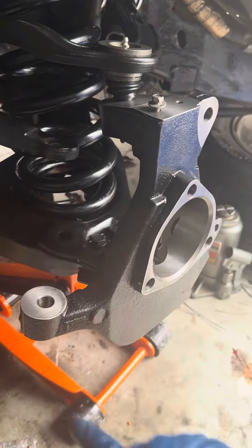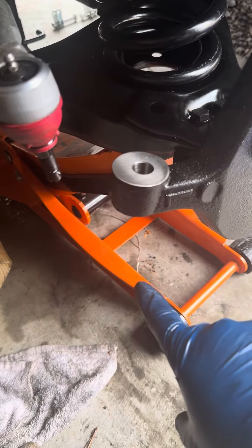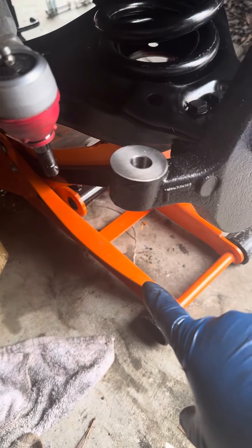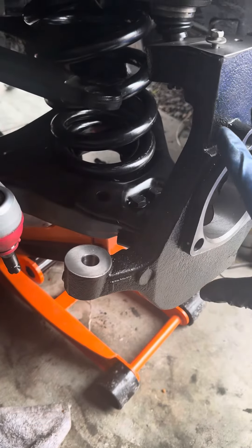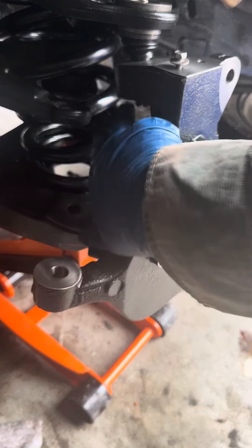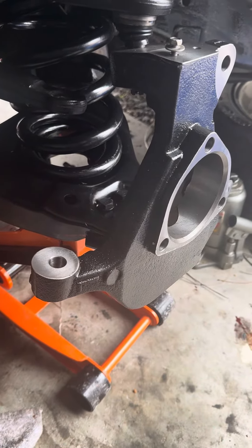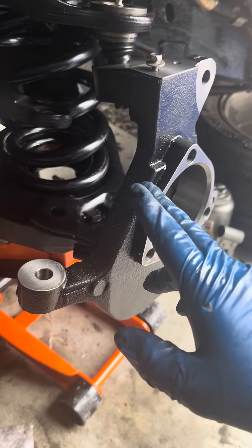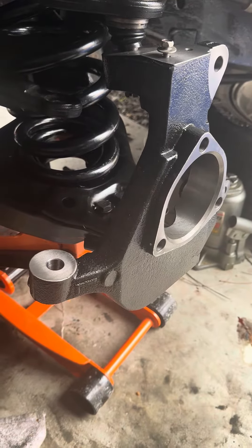You had to compress this back in, so look down here and you can see I've got a three-ton jack. I've come in from the opposite side and compressed that spring upward enough to where I could now inset the knuckle and set the castle nuts. I'm going to go ahead and install the shock because that will give me some support too for that spring.